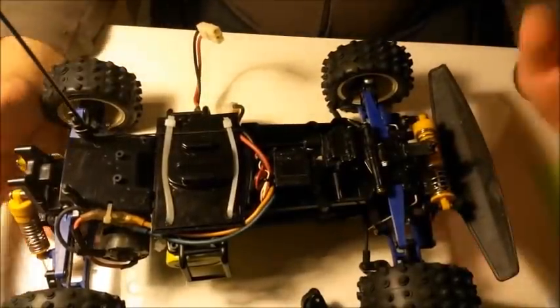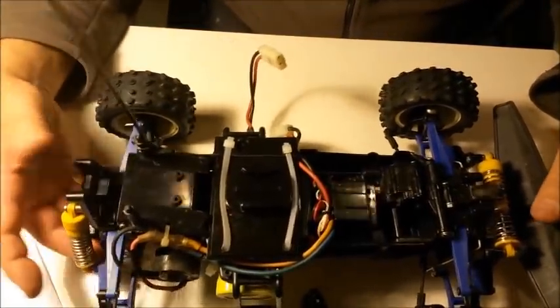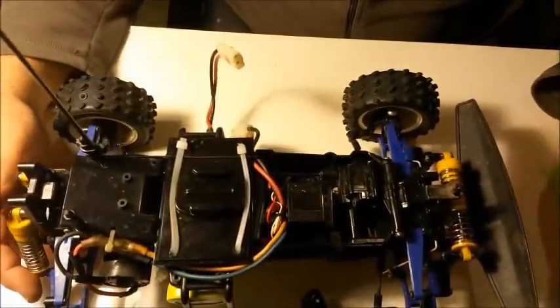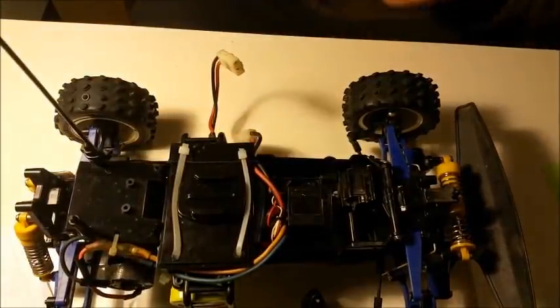One thing I didn't show you was the chassis repair. I don't know why I didn't show you. It's a piece of steel that I keyed back the plastic behind it. I glued the part that had broken back on, but that was going to be weak. What was I going to say? I glued that piece of steel in with epoxy, gave it a bit of satin black, and it's good to go. The other problem, I guess, was the rear suspension. It's just got front shocks, so it's obviously not up to task. But look, for what it is, which is a broken gearbox and a whole lot of trash, well, it turned out very well. I couldn't be happier with it.